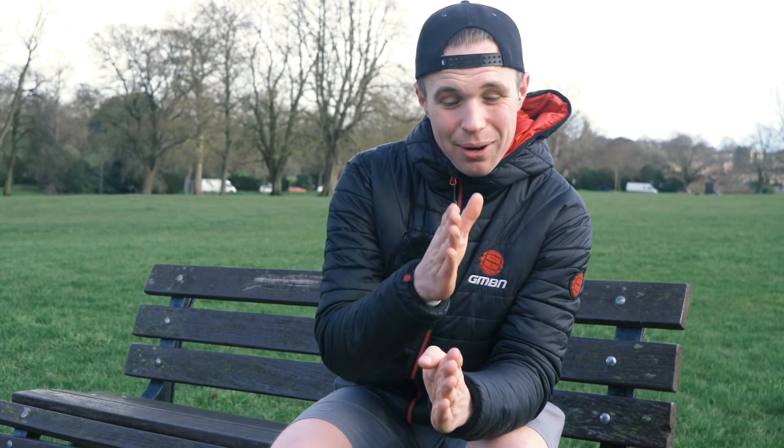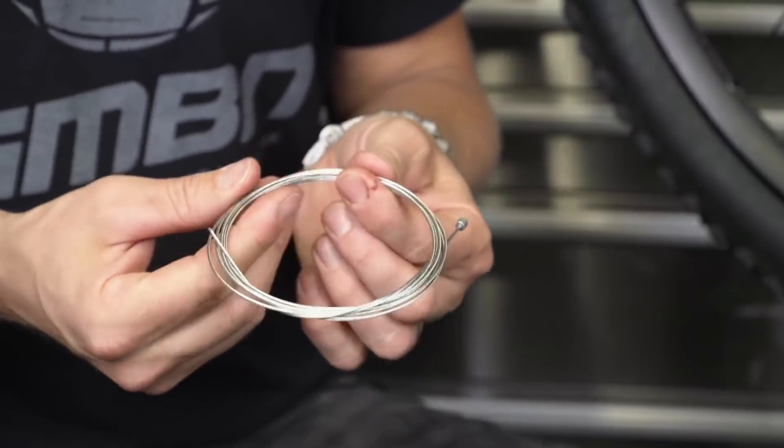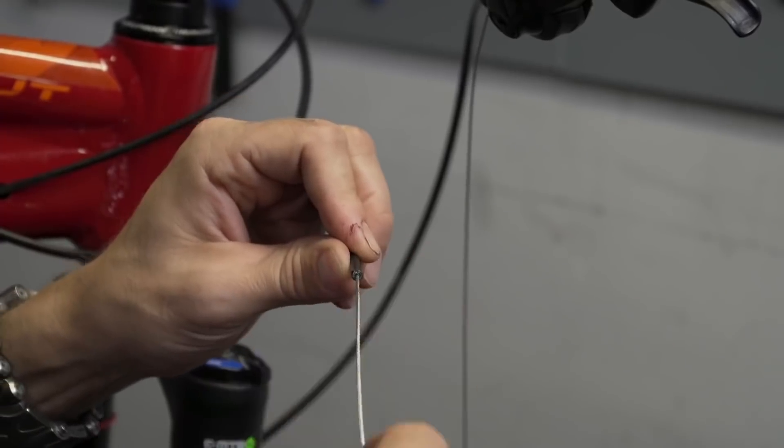Once you have the jockey wheels appropriately far enough away from the cassette to clear that 50-tooth, it compromises the shift as you go to the smaller sprockets. The shift can sometimes become sloppy or not that punchy when going to the higher gears, which are the smallest sprockets. If you are going to do this, a new cable with less friction will help give more precise shifting to those smaller cogs, but it will be limited by the B tension required.